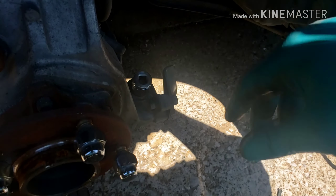After loosening the nut on the top of the tie rod, I had to smack it out with a hammer — give it a few love taps — and it came right out. I did have to remove this little steering bracket spacer thing so I could get a good lick at it and it popped right off. But when I was removing this bracket, I found that bolt was already stripped out. Being an idiot, I left the nut on the top of the ball joint while smacking it, and once it came out of the steering knuckle it was a pain to remove — I ended up having to cut it off. So don't be like me: just take the nut off first, then smack it down.